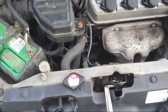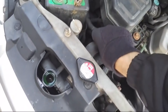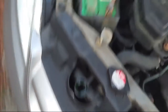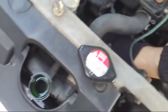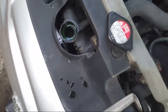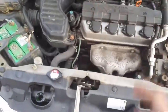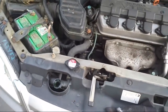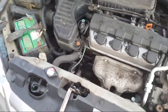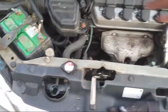I'm going to go ahead and squeeze the radiator hoses again. Basically the car's been overheating, and this is an issue common with Hondas. For one thing it didn't have enough coolant, and even though I keep thinking I fill it up, I've never properly burped the radiator. What that means is get all the air out of the radiator, which keeps the coolant from going into the engine. First I made sure the car was on a basically level surface, made sure the engine was cool, got out of the car for a few hours.